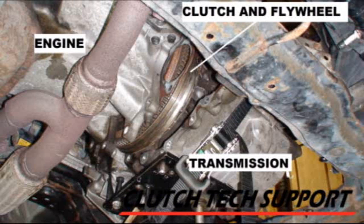The transmission must be carefully guided into position so that the input shaft aligns with the clutch disc and slides in. The transmission should go all the way up to the engine on the dowel sleeves or pins before you start putting the bolts in. Don't put the bolts in and pull the transmission into place with the bolts, and don't let the transmission hang on the clutch disc — either practice will damage the clutch disc.